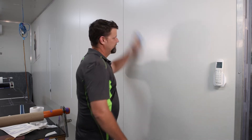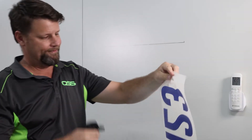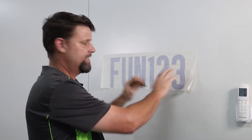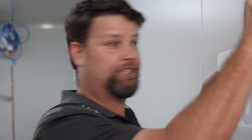Use a rag and isopropanol alcohol. There are three main ways that you can put a sticker on. First way is putting it on wet. Get yourself a ruler, measure where you want the sticker to go, get the sticker, remove the backing film, apply a little bit of soapy water, get your squeegee and bang it on the line. Good thing with soapy water is you get a couple of goes at it, you can move it around — it'll slip on the surface.